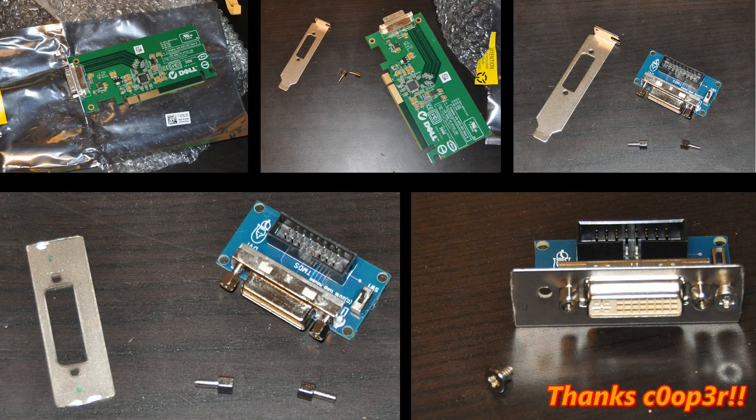There are a couple of minor issues with the design. The first is the connector — it ships with a piece of tape to tighten the tolerance and help it stay in place, but the adapter can still pop off if you're not careful. Also, the external DVI header doesn't come with mounting hardware, so it just hangs out the back. If you want to mount it to the rear panel, you'll have to engineer your own solution — here's what one of my subscribers, Cooper, came up with, and I thought it was pretty ingenious. These points shouldn't dissuade you from buying one if you're so inclined — just be aware of them. For technical reasons, this adapter only works with a ROM 3 Apple IIGS, so be aware of that too.